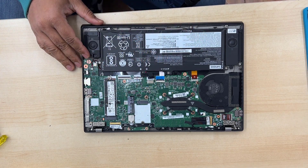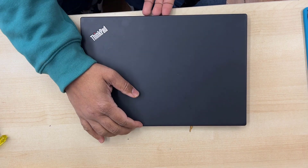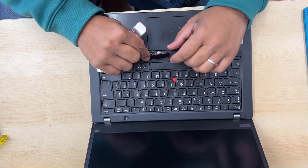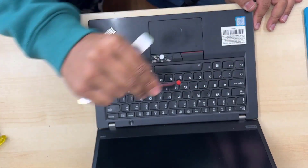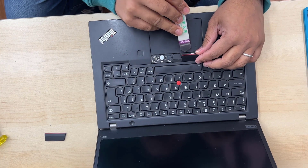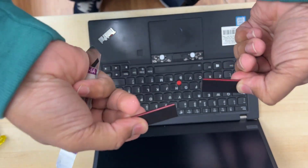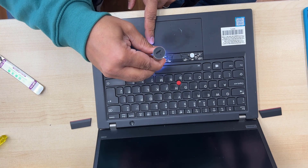This keyboard panel doesn't have any screws from the back motherboard, so don't worry — you don't need to remove any screws until now. Then we're going to take a flat opening tool and start spudgering. First, we're going to take out these two buttons — the right key and left key. Lift it up exactly the way I did, so you're not going to break anything. Once you remove these two tabs, you're going to find there are two screws just underneath. We're going to unscrew those — two silver screws, one at the left and another one at the right.